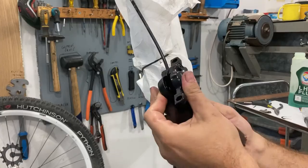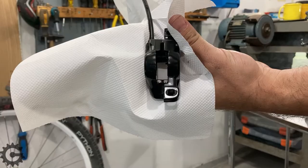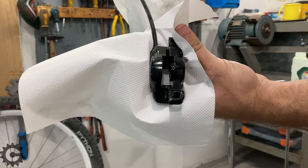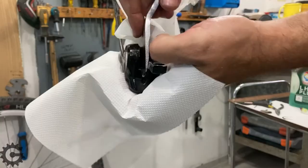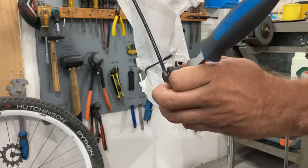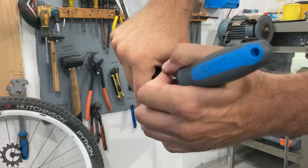Both calipers are now pushed all the way back. Now let's pump up the lever and see if they move uniformly. It didn't seem to help, but sometimes you need to just work them out a bit — that's what I'll try to do. I'll hold the stubborn one with my hand and try to make the other one work a bit, then push it back. Let's give it another try — better, but still not perfect.